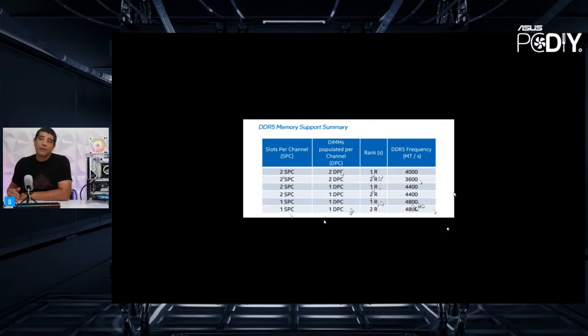13th gen becomes even more impressive. With 13th gen, the majority of CPUs can hit upwards of 7000 or even greater MT. So they even have a higher performing memory controller. And that does translate if you move a 13th gen CPU over to Z690. Instead of running 13th gen on Z790, which has a little bit better memory scaling, generation to generation you usually see maybe an uplift of about 400 megahertz, or maybe more than that, clock to clock, right?